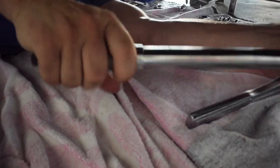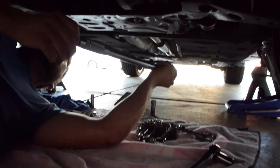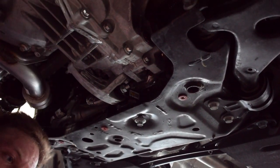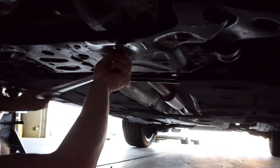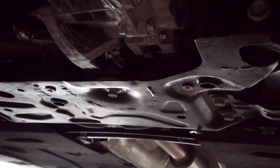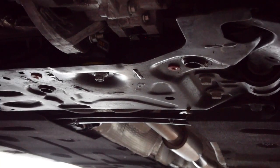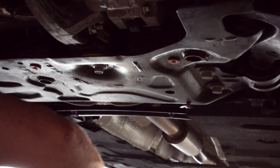We're looking at the torque wrench now. One thing at the dealership we didn't do was torque this to spec. For the bigger bolts it's 60 foot-pounds — I did 65, just to be safe. For the smaller ones it's 30 foot-pounds. I looked it up online — they give it in newton-meters, but I did the conversion and it came out to roughly 60 and 30. When I asked the tech at the dealership, he just said 'tight.' Most people over-tighten everything, and while over-tight is better than under-tight, some things you don't want to over-tighten.